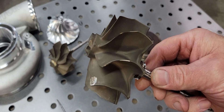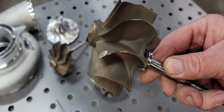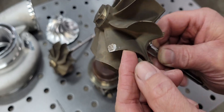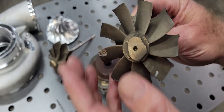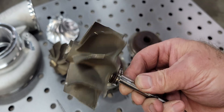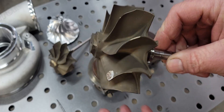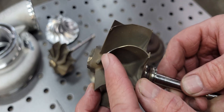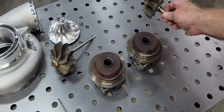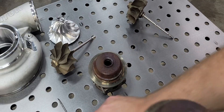Short version: we have turbine wheel to turbine housing contact that is pretty severe in this case. You can see the markings are still on these turbos — they have just a handful of passes on them. All I've done is pull them out and run them through the ultrasonic to get the oil off. This one was on the verge of being catastrophic.